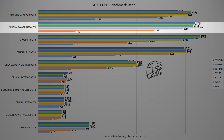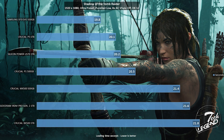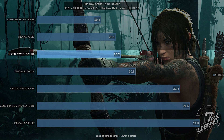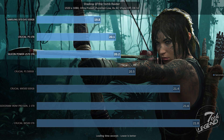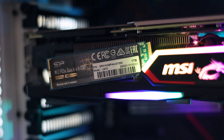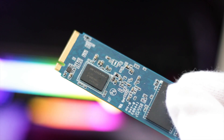The Silicon Power US70 1TB would be even faster if the tested platform had PCIe 4.0 available — in this case, the SSD is limited by the system. In the Game Level Loading Test using Shadow of the Tomb Raider at 1080p with DirectX 12 and maximum settings, the US70 1TB required around 20.2 seconds to load the level, placing it alongside drives like the Crucial P5 and Samsung 970 EVO. The SSD reached a peak temperature of 68°C with an ambient temperature of 26°C, which is quite good given it was reached under a synthetic benchmark.